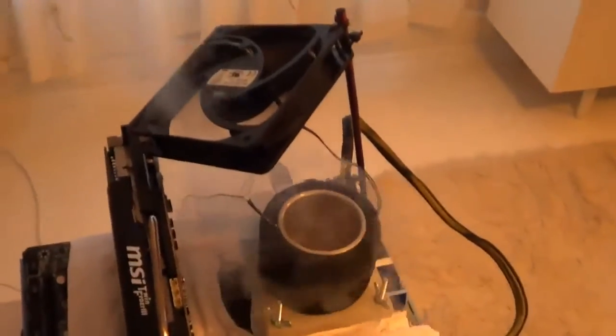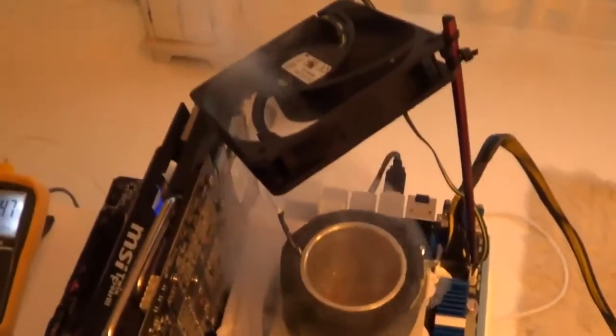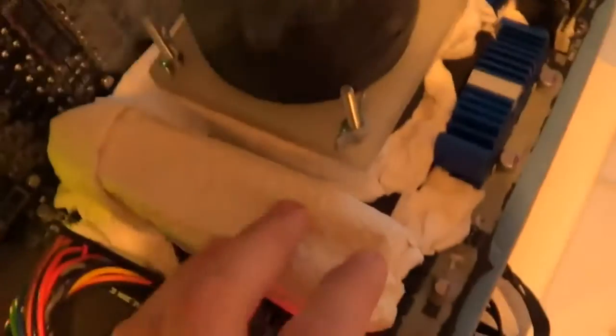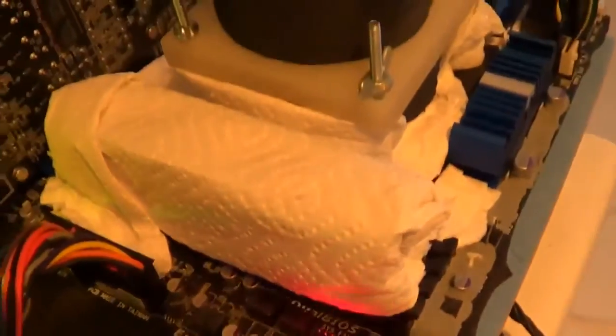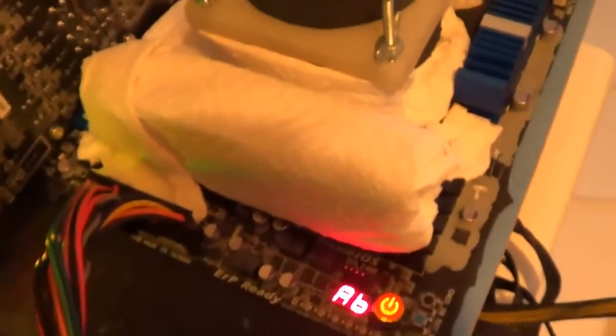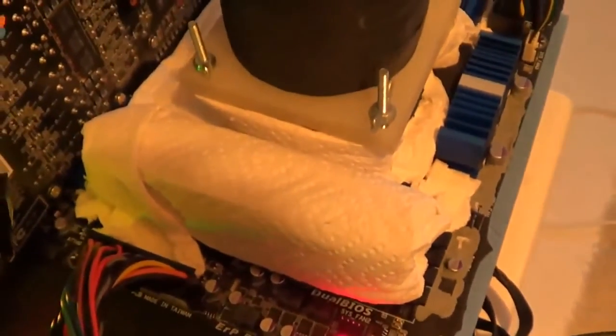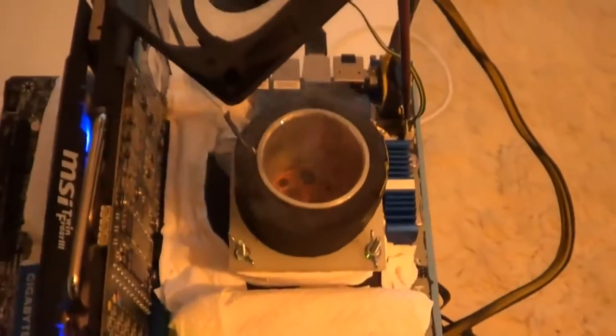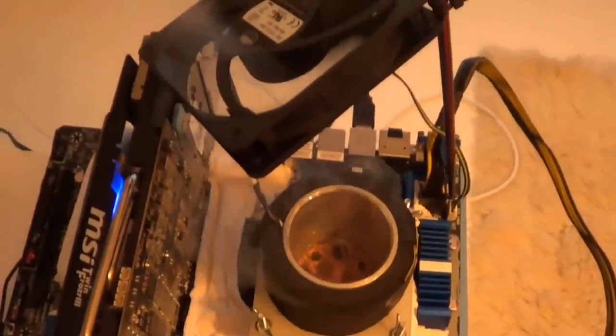It's the same as in Dinos' video: make sure you have a fan taking all the cold fumes of the liquid nitrogen away from your system so that it doesn't fall and cool everything down. I close my memory up like this because it gets really cold and then creates water, and I don't like that. Also my memory doesn't need a fan because the chips are Samsung and they really don't get warm at all, no matter what volts.